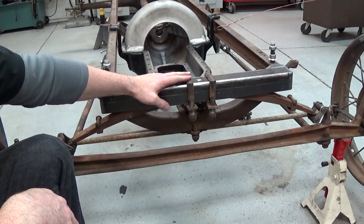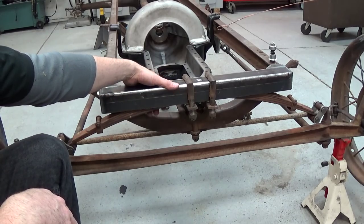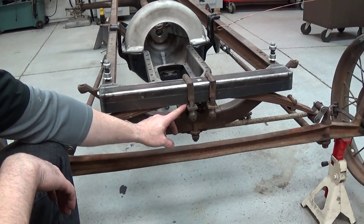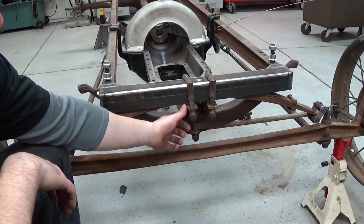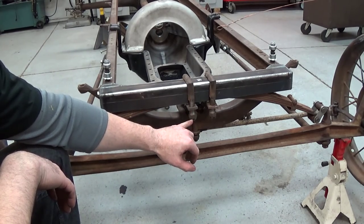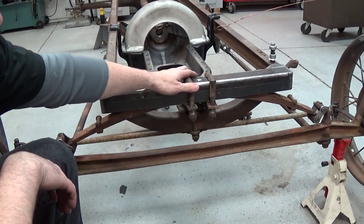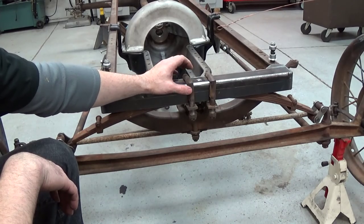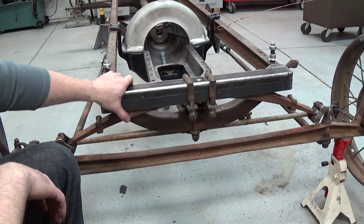We reused rear shackles — got an extra set because the front spring is so much thinner. To fit the spring up in the channel, we made a block that goes underneath the bracket to push up against the spring. There's also a spacer — I made a bunch on the lathe quickly — to keep the nut in the correct position so you can cotter pin it. The frame is drilled with two holes because these brackets have two pegs that fit through to keep them from walking, and then someone had to file the square hole for the front spring bolt.